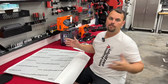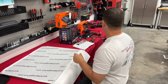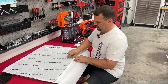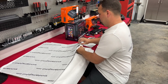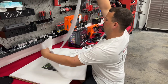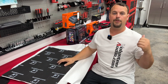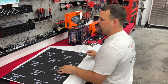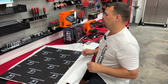Make sure it's pushed all the way in — looks great, and that putty's going to make sure it doesn't vibrate out. So we're making good time. We've already got the rear speakers installed. Robbie's already pulled the radio and swapped the grills. He's got the front pods on the counter. I'm in the middle of prepping our Soundskins — Soundskins is really cool, it's a self-adhesive sound-deadening material. These kits are completely already cut out into every shape we need for those pods, so I'm going to tear these out and get all of our pieces ready while Robbie gets the speakers out.